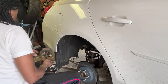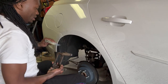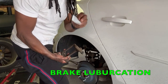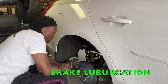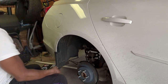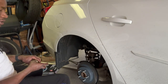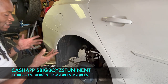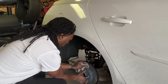Screw the bracket back onto it, y'all, before you put your brake pads back on. And I'm gonna put a little brake noise lubricant behind the pads. Because it makes the pad — it takes the noise out of the pad, y'all, basically. One thing about it too — when you're putting these rotors, I'm going to try to keep it clean as possible, like no grease on it. I kind of messed up a little bit — what happens is it doesn't really stop properly, or you'll have squealing.